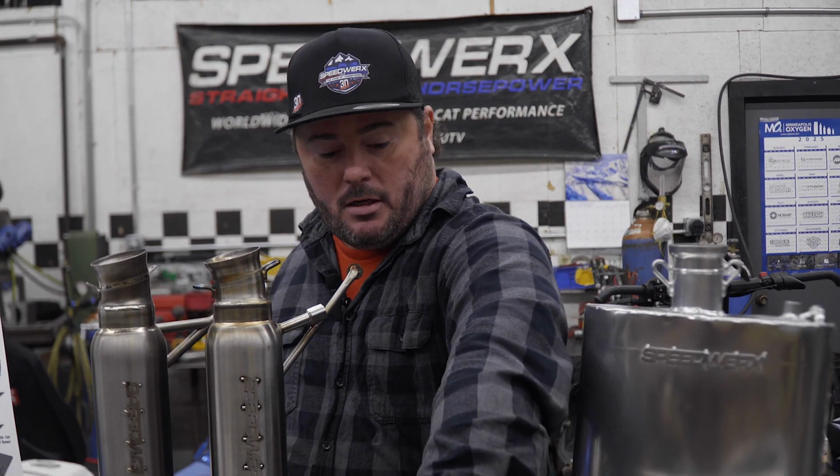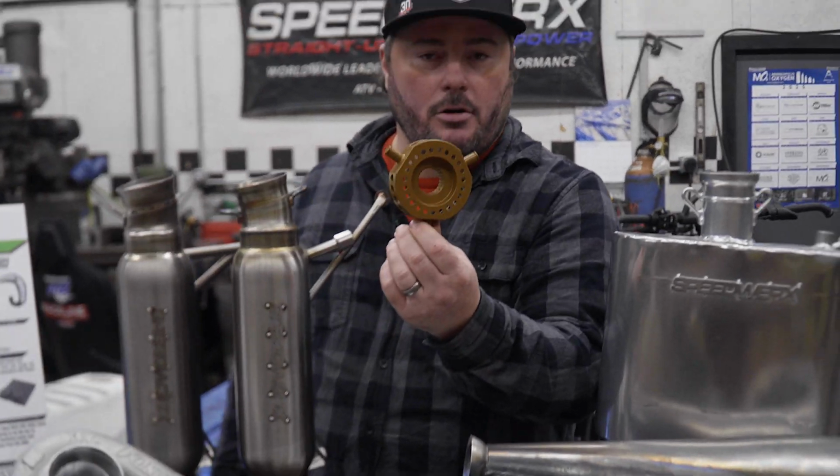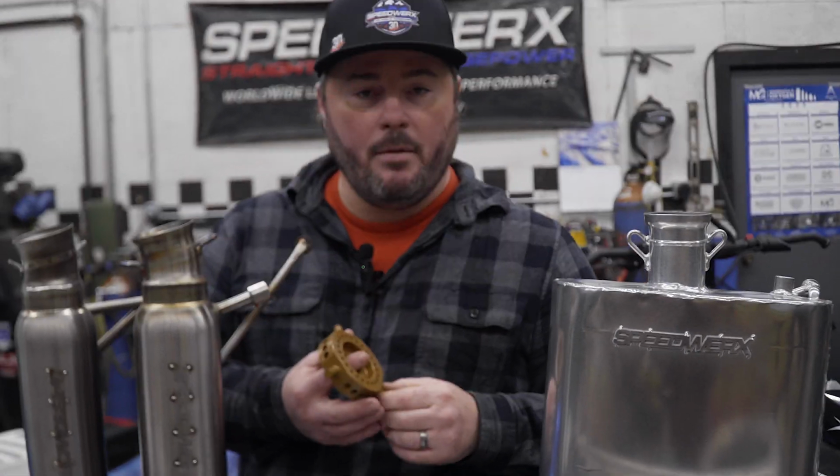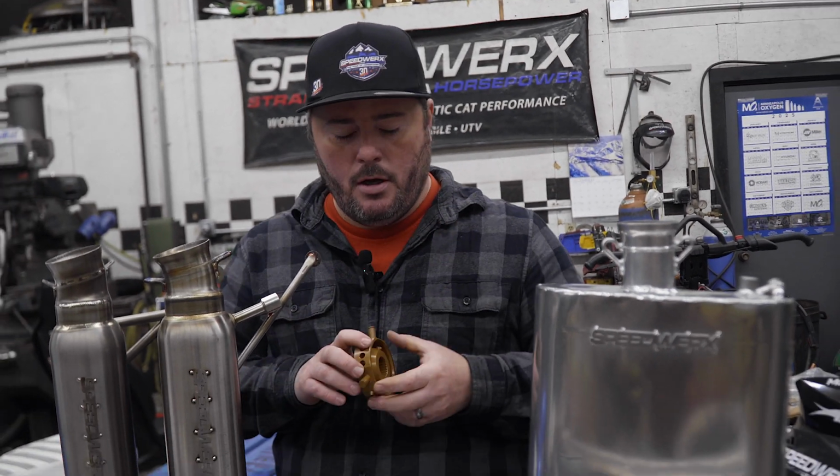For those of you that have never done anything with rotating weight, that's huge. Those of you that know and have played with it before, you probably already have these parts on your sled or you're already ordering them right now. And then some of you have probably noticed, hey, what the hell? There's three studs on that spring cup. Yes, we are working on a 3-spider, 3-roller helix setup.